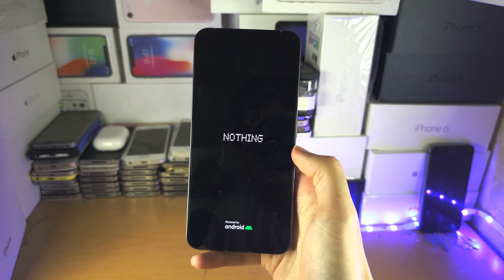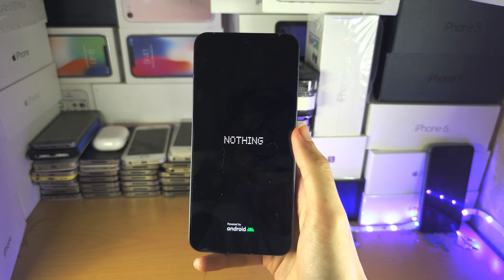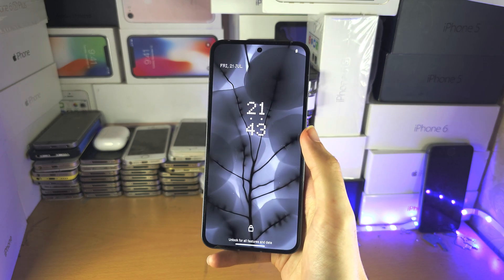Any second now we see the Nothing screen — release your fingers. Give it a shot, that should fix it for most people. If it does not, then the screen connector or battery connector has disconnected. Before we attempt the next fix...